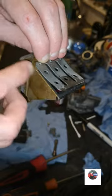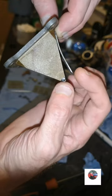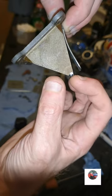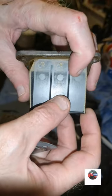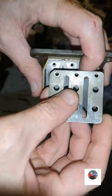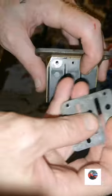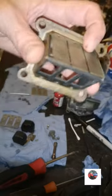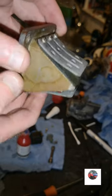So we'll put the petals in, put these in, put the three screws in with Loctite, and then I'll get the manual and measure what distance there should be between that one and that one, with that metal bit on there like that. So now I'll get the reeds on. They're all clean, that's which way they go. As I showed before, there's the flat bit that lines up with that flat of the metal part. See how it's slanty on there, slanty on there. So we'll just put these three screws in with some Loctite. Do it on the other side as well. That's them all on now. Three screws on each side with Loctite.